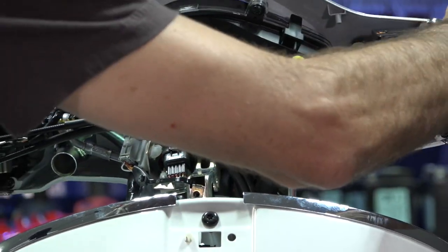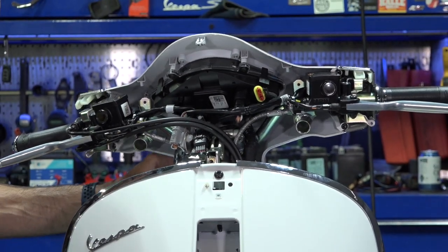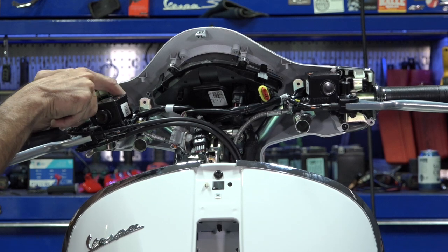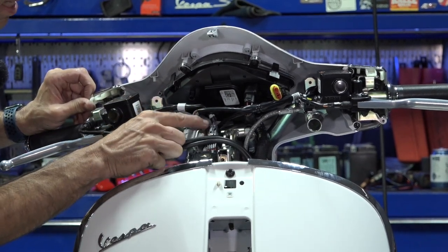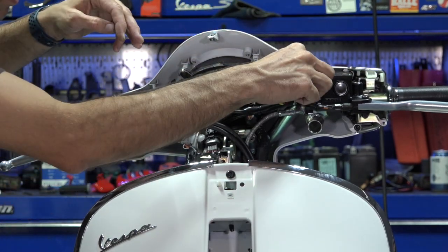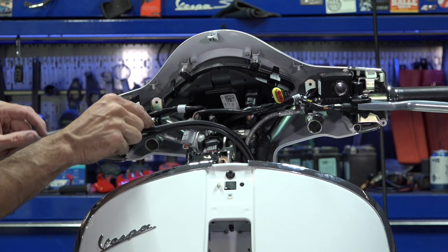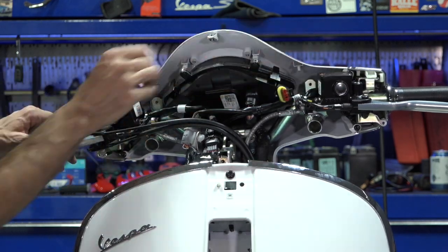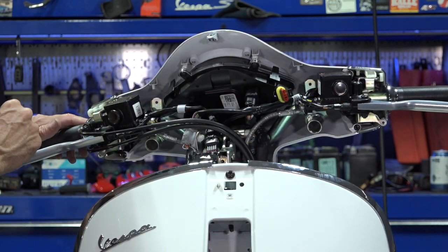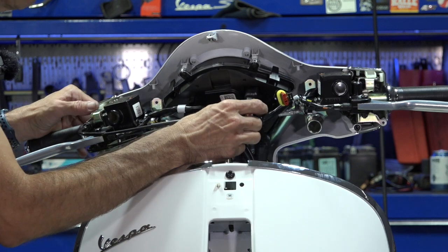At this point everything's fairly loose, but there's a lot of wire still holding the handlebars back. You have a wiring harness from the right handlebar switch going to a black connection — there's a tab to release it. The left handlebar switch routes through here and has a zip tie trapping it to a gray connector. They also have zip ties holding the wiring to the brake master cylinders, along with a pair of wires going to your brake switches for both left and right.